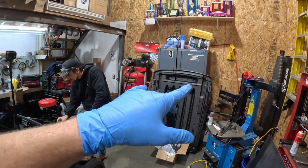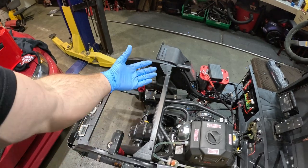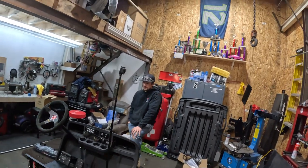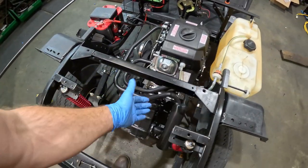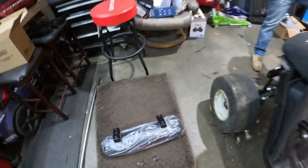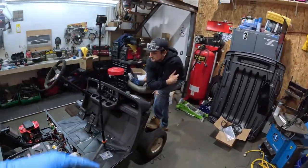Brackets for the compressor, brackets for the tank. We made one modification from when you guys saw it of us holding it up. The brackets are actually going on top now instead of below, because there was not enough cushion. Once we put in the rubber bushings for the tank for vibration, it hit the exhaust. So we had to plop her on top, getting them painted, getting it put on.